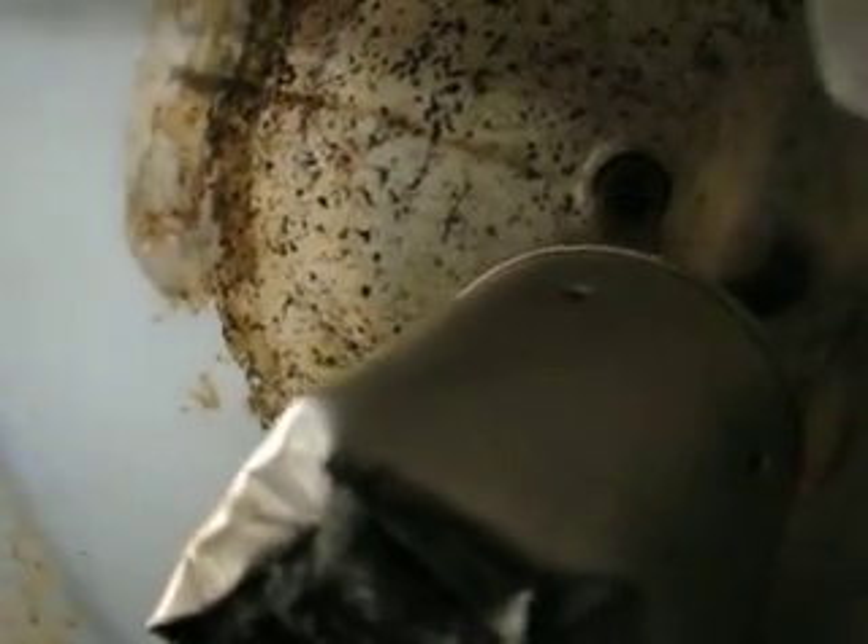Another thing I noticed with the vapor systems is your fuel can be dirty — there's a bunch of dirt and stuff in this fuel, it's dirty up in there. This other part of the can has a fitting going to the hose; the hose runs up here and it's sealed off, and that's filled with steel wool. That's where the Geet draws through with a few holes in the sides for fuel to get in. My theory is that once the steel wool is filled with gasoline, when exhaust gases go through it, they're forced to choose paths around the steel wool and be less likely to remain liquid — getting into a vapor state.